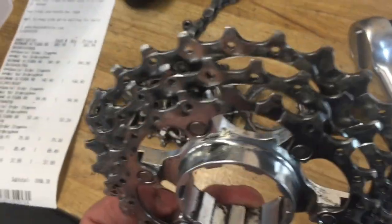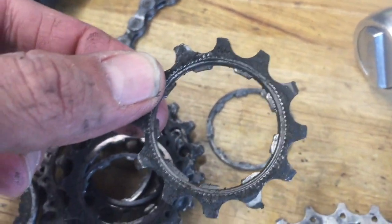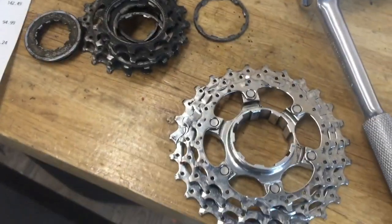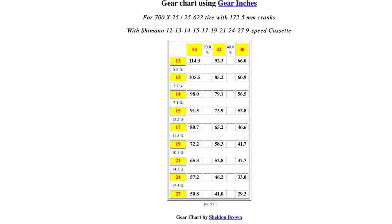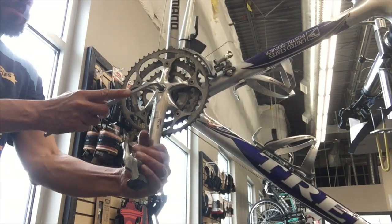So this is the old Octolink Shimano. The cassette was a 9-speed — it was an 11-27, which I don't think you can even buy anymore. You can get an 11-28 or 11-25, I believe, which is more or less a generic, maybe Tiagra level lower-end. But this is the actual gear combinations on Sheldon Brown's site. You can access this, put in your own gear ratios, and see what kind of gear inches you're getting. Basically we had a range of 114.3 to 29.3 or something like that.